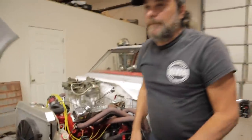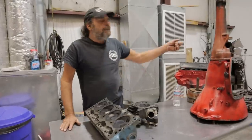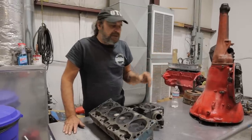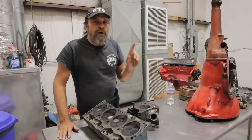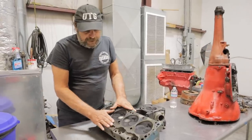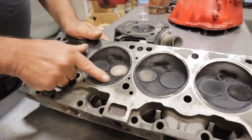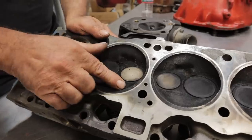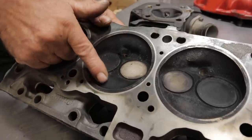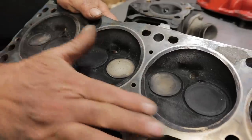So now let's go back to the combustion chamber, or the cylinder head here. I'm building another 318 and I want it to be a maximum output 318. I'm using 360 heads - 343, 360 heads - because I want the bigger ports and the bigger valves, but I don't want to go with a Magnum-style head; I want to stick with an LA-style head. One of the problems is that LA-style heads, like this 318 head right here, are open combustion chamber. This area right here is known as a quench pad, and in this case there is no quench. It's an open chamber, meaning the deck is at one height and this pad here is at another height - about 90 thousandths of an inch or so. If this were a closed chamber head, this quench pad would be flush with the deck surface.